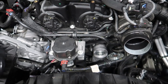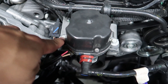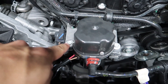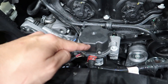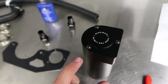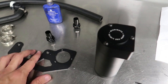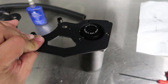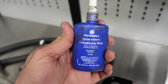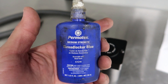Moving on with the install. Now we have all the room we need to access the front of the engine bay. We'll need to loosen these bolts right here — we have to loosen but not fully remove this part. The plate is going to be sandwiched with this part. Moving on to this side, we need to install the catch can on the brackets — you have these three little bolts. Make sure to put some Permatex blue thread locker in those, so this will hold the bolts in place. It won't make them super hard to get out, but at least it won't vibrate out of place.